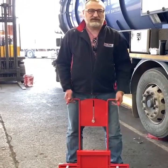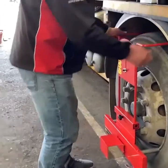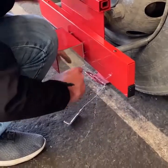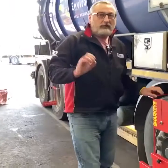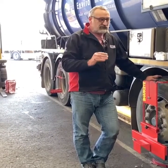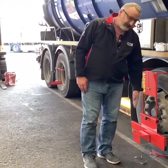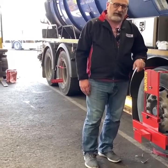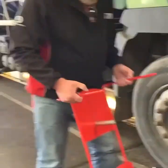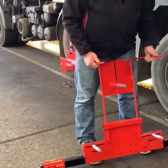Second steer mirrors on the second steers — make sure they're on, make sure we've got reflection. We haven't got reflection on the rear — this is what you get with some trucks, and this is why you've got the rim button extensions that come with it. Some trucks like Scanias have an indented wheel. This is a high nose, so these are in parallel — the way the gauges are done, this sticks out a bit further. So what we do to get around this is put the extensions on the front heads. This is why you're paying so much money for our kit — it's all lovely machined and well thought out, all precision rim buttons. What Evan's going to do is put the rim button extensions in so that we can get a reading on the second steers.